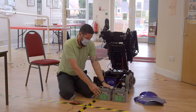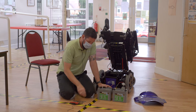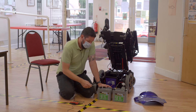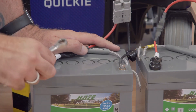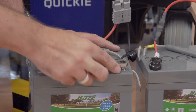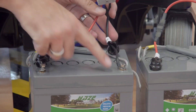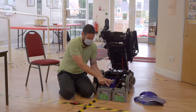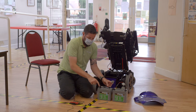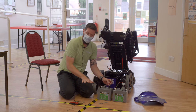Once you have the batteries out, you'll see two connectors — a positive and a negative. These are connected by two bolts, generally 10mm in size. Take note of the colour and the plus and minus markings: red goes to plus, black goes to minus. You may not have a plus and minus marked on the top of the battery — it may just be colour coded red to red and black to black. Any concerns, call us and we can give you advice.